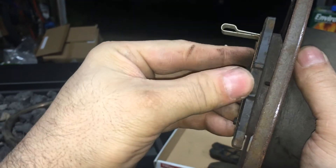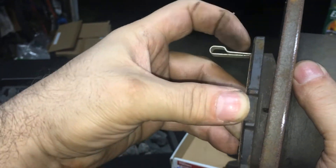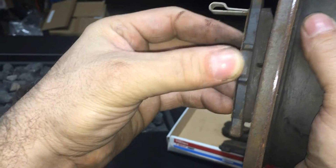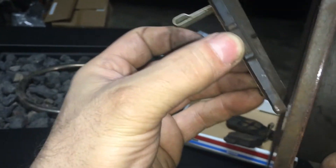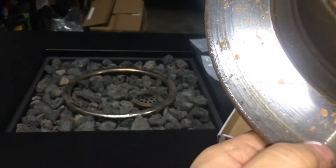See how the pad is on an angle — your wear mark is on this side. That would have been real bad. You're going to eventually eat into the rotor, not that it isn't already uneven on this side.